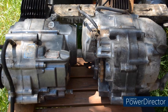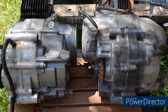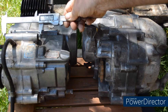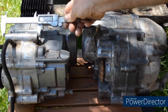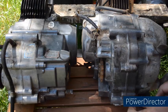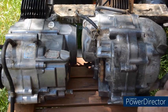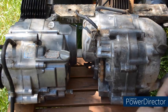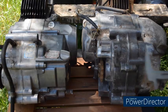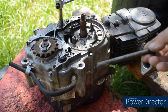So with the engines side by side, we can have a look at the subtle differences. On the left is the Li-Fan, on the right is a Honda CT110. On the top mount you can see it's just about 96.5mm and on the Li-Fan it's quite significantly narrower. And also on the bottom mount. We need to move the engine across to keep the chain line straight. And the first thing we need to do is drill out the bolt hole from M8 to M10 to accommodate the Honda mounting bolt.